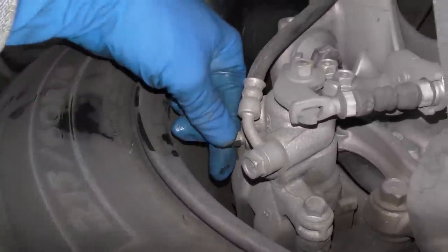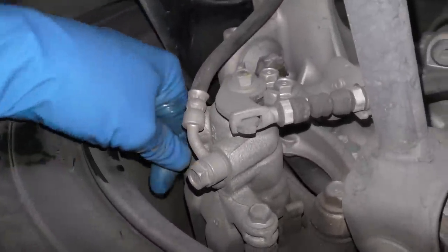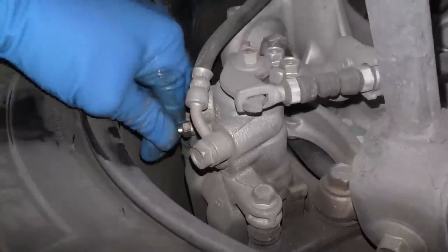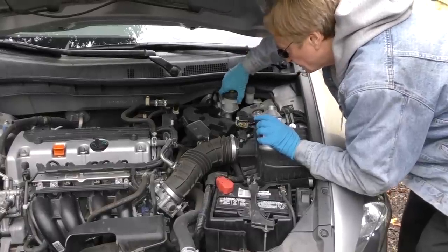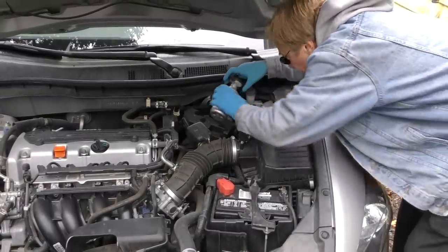You got to take that rubber tip off. In this case, it is kind of stuck on. I'm wiggling it. It can be a pain in the butt, but there it is. And we'll bleed this side the same way. Just remember, do each one 5 or 6 times or so, so you can get all the fluid out of both the caliper and the lines that feed it. And of course, check the master cylinder and top it up while you're bleeding, because you don't want the air